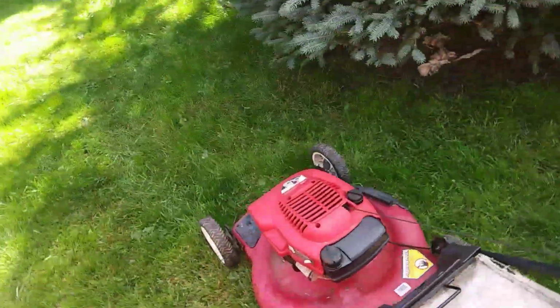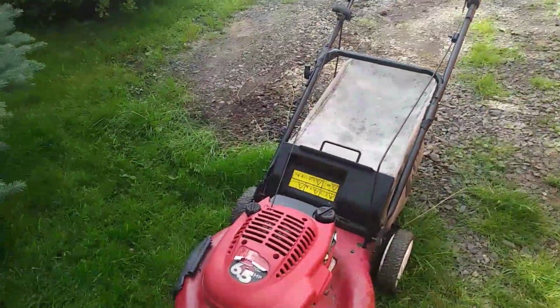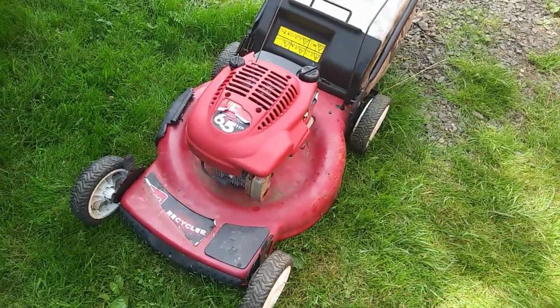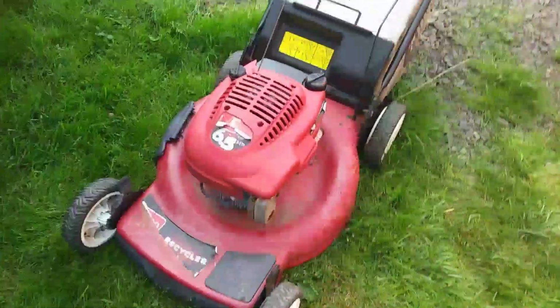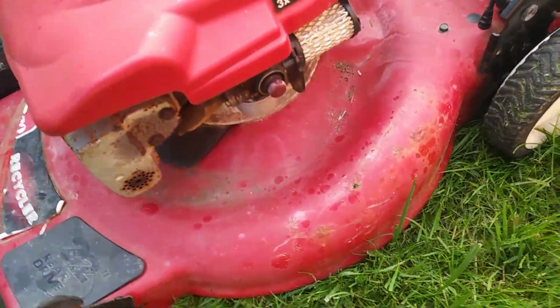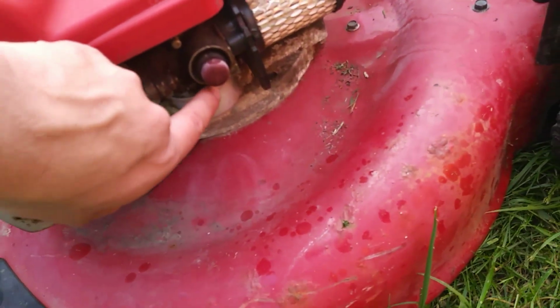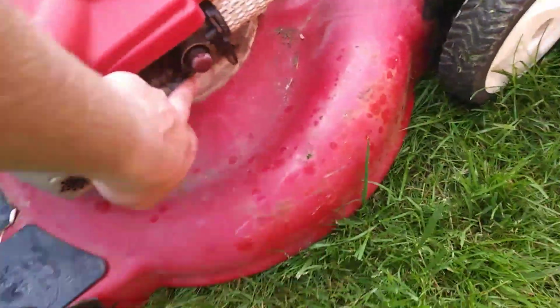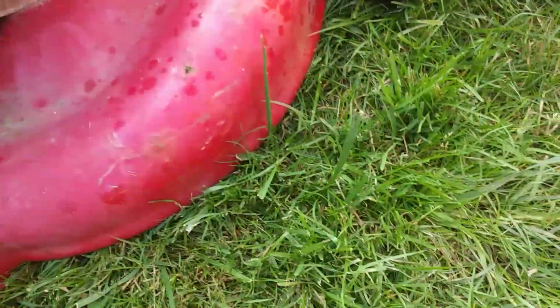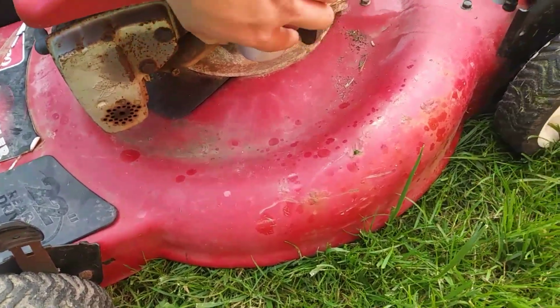Okay, this is the newly acquired Toro. I think this is Toro number 12. It looks just like any other Toro we've picked up with the 6.5 horsepower Tecumseh. It actually came complete with a new filter. All it needed was a carb gasket right there, because the one it came with had a huge gap in it, and so when you put gas in it, it would just dump out. But it would still start and it would still run. I was amazed. I didn't even have to, well, I did prime it, but the primer bulb is shit.